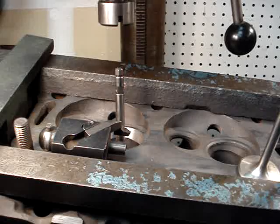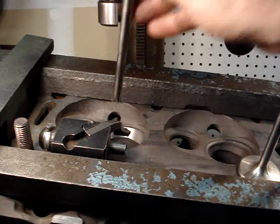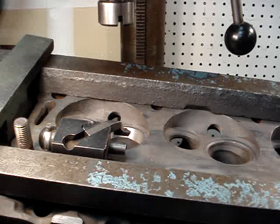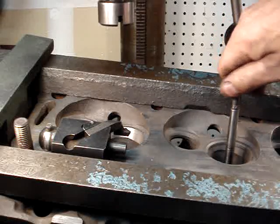Obviously, we're going to have to do some seat work on this. So I want to walk you through that. The head has been leveled. Big block heads have canted valves, and so the valve is at kind of a unique angle. That's why the cradle — we've got to set this cradle up at a pretty dramatic angle to get our guided seat leveled.